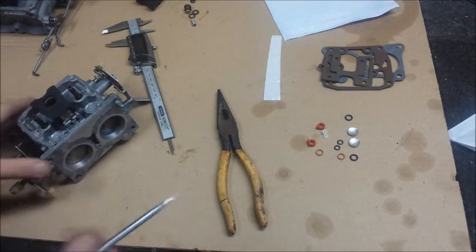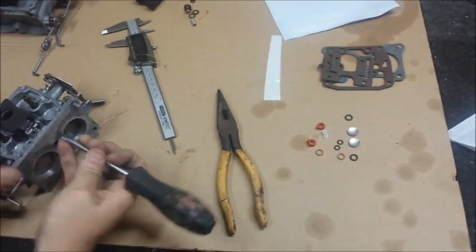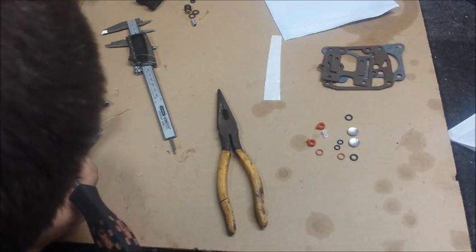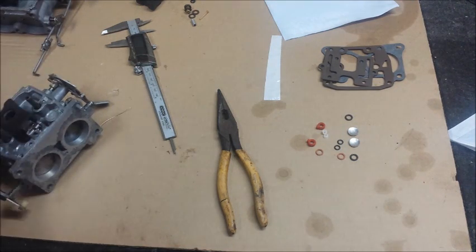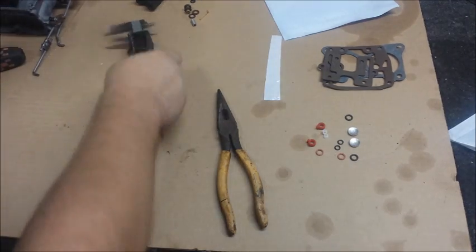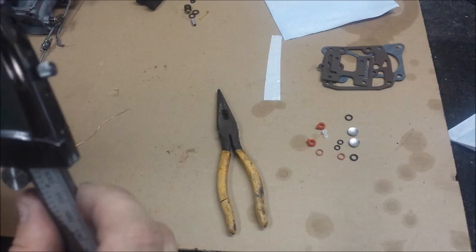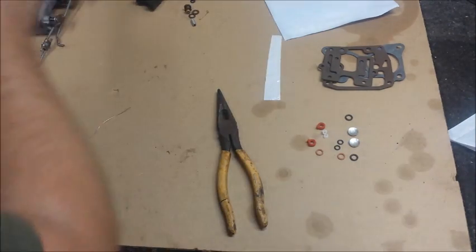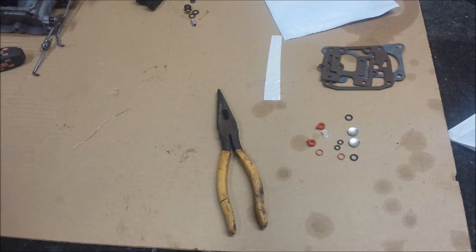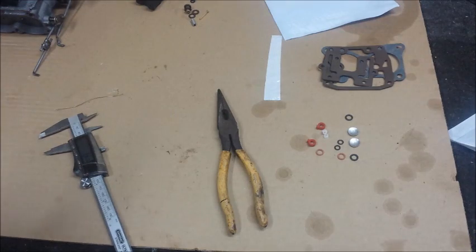Adjust that. There's a tab on the back of the float — push that in. In my case, about a 64th of an inch, which probably translates to a little bit of pressure and you're done. And we are at 31/32nds. You see how I did that? The camera angle looked way different, but when I look at it, it's there.